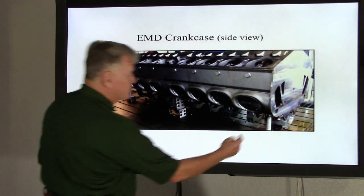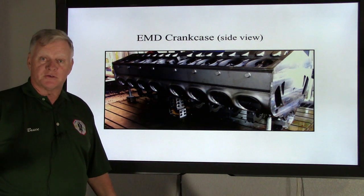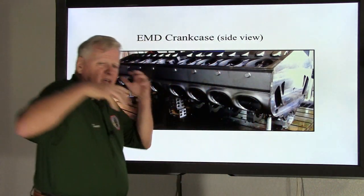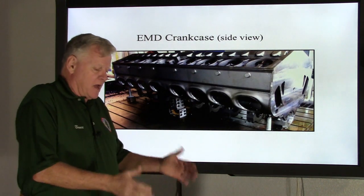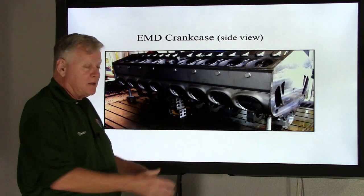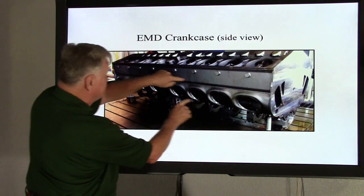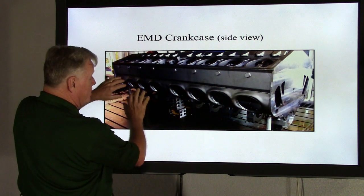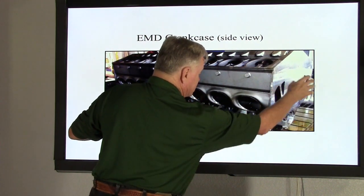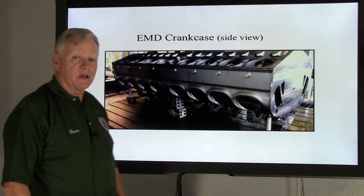The air box is where the air enters through these two openings. The air enters from either a blower — also known as a supercharger — or a turbocharger. That air comes in very fast with a huge volume. At idle it's very minimal, but when the turbocharger or blower ramps up to speed, it packs a lot of air in this air box. This opening also connects over to the other bank, so the entire area swirls with air when this engine is running.